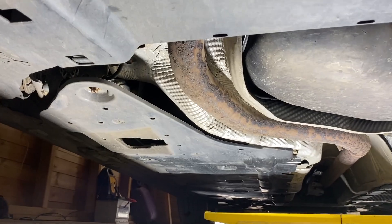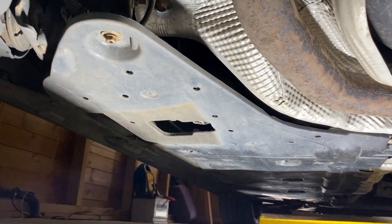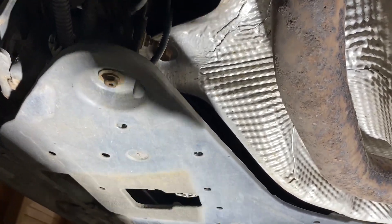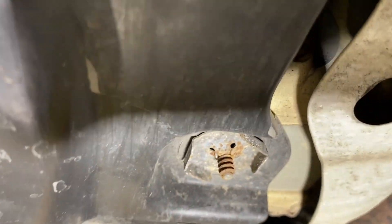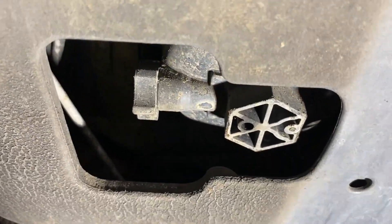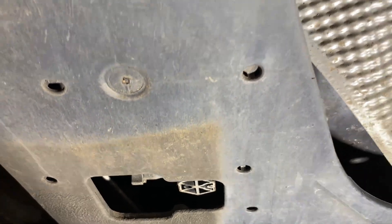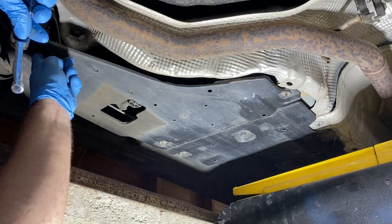We're down under the back of the car on the passenger side — the left-hand side, or near side in the UK. There's a 10mm bolt there and a couple of little thumb wheel things. They're 24mm. Use a 24mm socket to get that cover down, and then that exposes the fuel filter. It looks like about a 30mm to get on that.